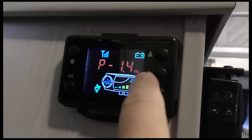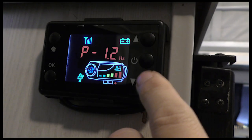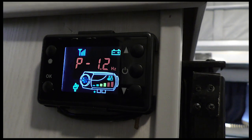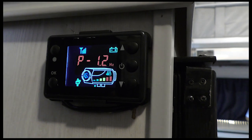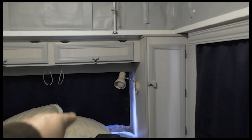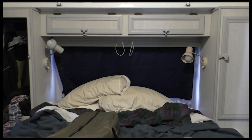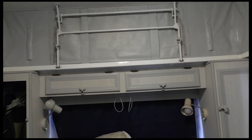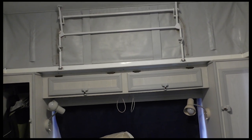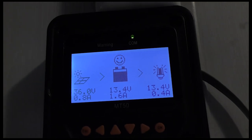Now the heat is up to temp — you'll see it's clicking away nicely at 1.4. We can turn that down to 1.2, which is its lowest setting, using the least amount of power. That just chugs away and warms the van up quite nicely. Keep in mind this is a 17 foot van, 14 foot living space to the drawbar — so that's roughly the size. We do have a pop top van. I've found that I can be in the caravan with the windows open or the pop top up with some of those windows open, and this is still more than capable of keeping it warm even on a low to medium setting. On the 1.2 setting, that is 0.4 amps.